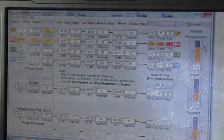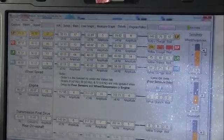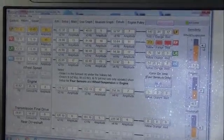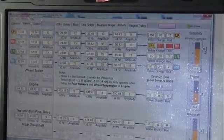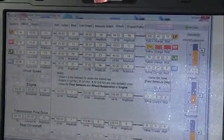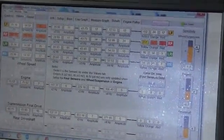Want to go a little bit faster, just to see what's happening. Now when I go faster, I can feel that vibration even if I'm just floating it. If I'm down around 50 or 60, I've got to be in the power to feel it. If I got up towards 70 and 80, I could feel it totally floating the car. So I don't feel it very much there, but if I get in it, I feel it now. Definitely is vibrating.